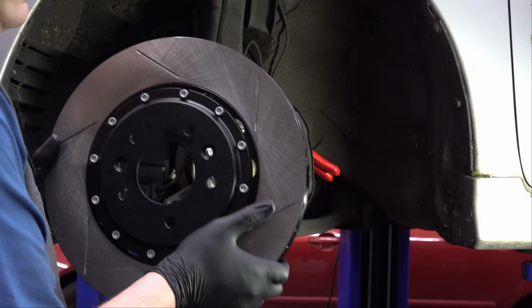Now, it's still got the packing and everything in there, so you'll have to imagine this a little bit, but behind these brake pads, there's 4 pistons. You can kind of see the little humps right here. So there's 1, 2, 3, 4. And what happens is those pistons move in and out within the caliper. And when those pistons move, they push directly on these brake pads. So you have even pressure all the way through the system, even force. Just a simpler design overall.